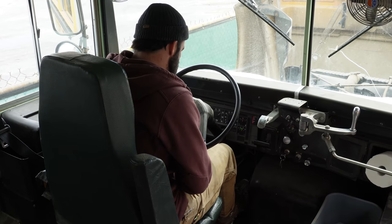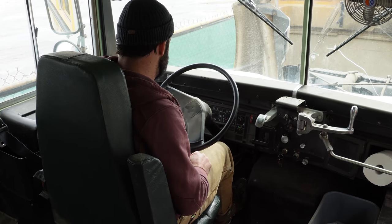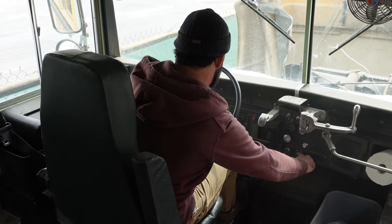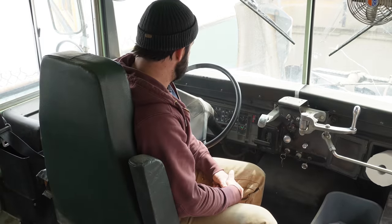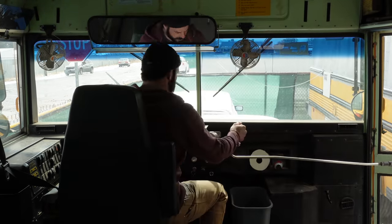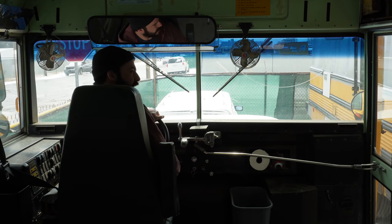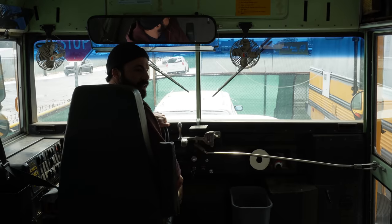To be expected. Now what I like to do is go ahead and set the throttle lock to about 1100 RPMs. And we'll just let this kind of wake up. It hasn't been running in months. We'll let this just kind of wake up and get a little warmed up before we pull it into the shop. All right. So I've let it idle, well, high idle, for a couple minutes. It's got air pressure, and I think most of the cobwebs are out. So I'm gonna get this old girl into the shop, and when it leaves, it's gonna be 12 inches taller.